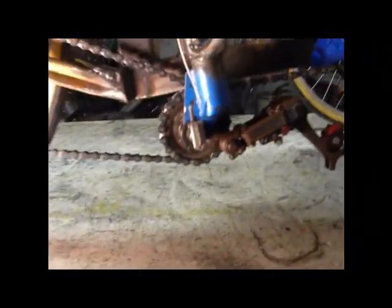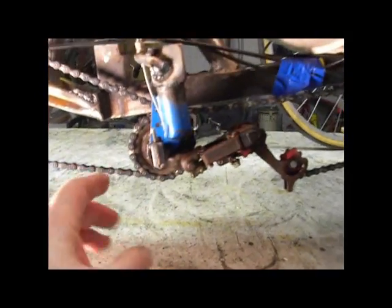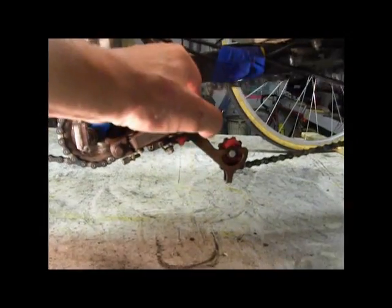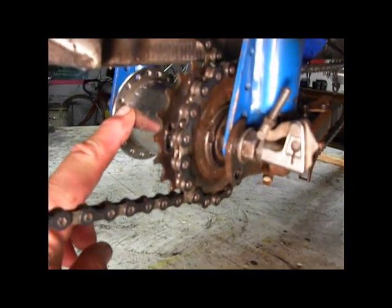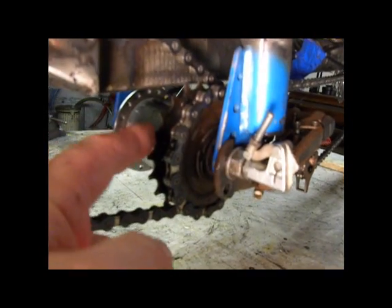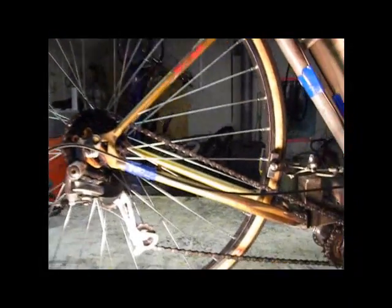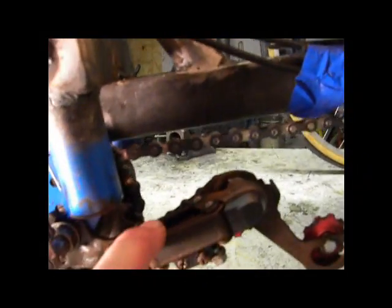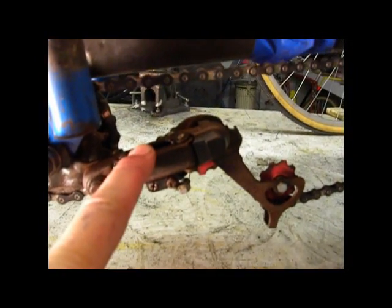This one here, there's a whole lot going on here in one spot. I took the sprocket on the other side and moved it to this side, so that it's chain drive on this side instead of the other side now. Now, I have a transmission here, and this is the drive from the pedals, and then it goes through this transmission and reduces or increases, and this drives the rear wheel. Because this was a long chain, I put a derailleur on it, which keeps this chain stable and keeps it from jumping off that sprocket.